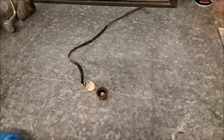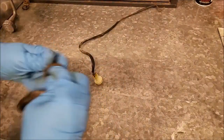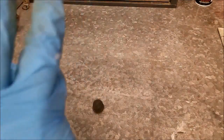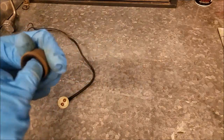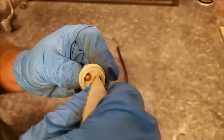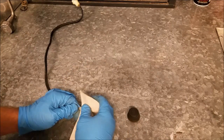For that, a simple piece of steel wool works. After you're done, make sure no little pieces of steel wool are left inside there because it's conductive and it'll jump the contacts and the engine won't run — so make sure you get it all out. You can also use sandpaper, which actually works a little better. While you're at it, cleaning the ring terminal and the pin terminal isn't necessarily a bad idea either.